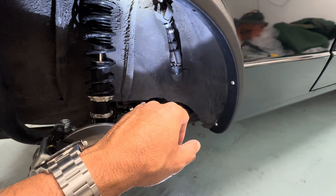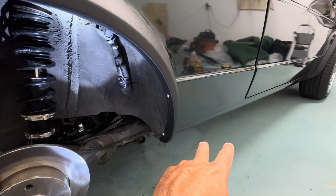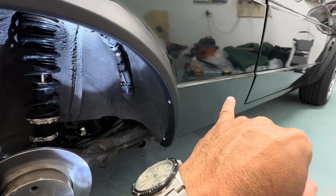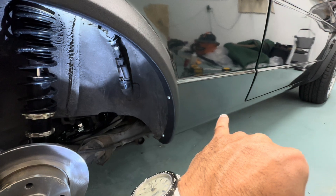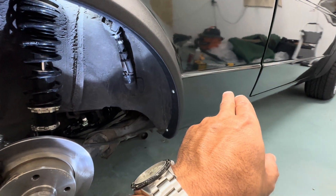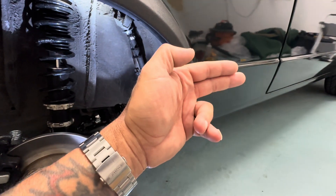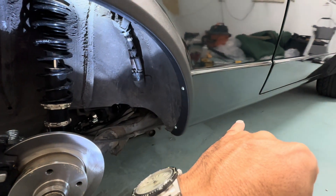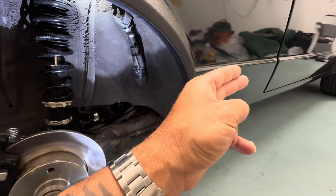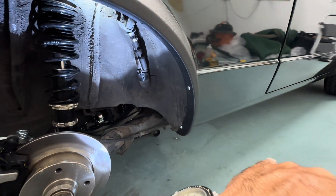This past weekend I also replaced the fuel filter — that's 100 microns — and I put another fuel pump in, but that fuel pump was too noisy. So I went on Walbro directly and ordered a fuel pump from them. In reality this is a gravity feed, so the tank has a little nipple that goes to the fuel pump with no filter in between. Ideally you'd go from the fuel tank into 100 microns to the fuel pump then to a 10-micron fuel filter, but I don't have the space for that. The tank has to feed enough gravity fuel to the pump or you'll starve it and kill it.